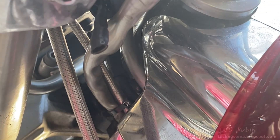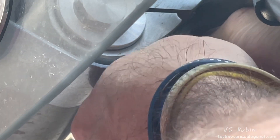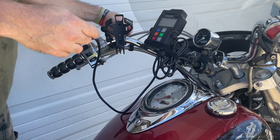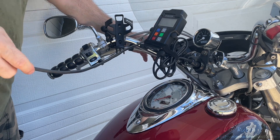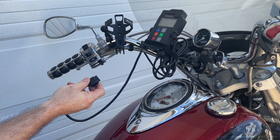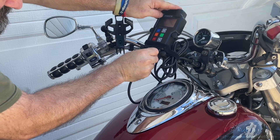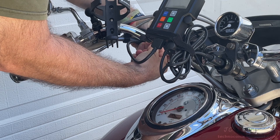I have a sealed connector up front that I've opened, hanging off the tachometer, that I use to get the engine speed signal. I plug my cable from the multi-purpose harness into that now. Wrapping that wire around the bars just one time, I then plug it into the bottom of the unit, and the slack from that cable is tied up onto the handlebars.